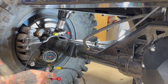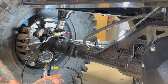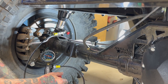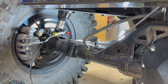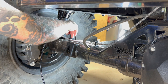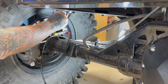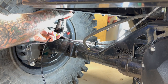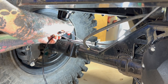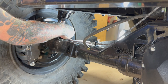When I open this valve it's going to allow me to increase the pressure in the strut, so we're going to go up to about the same as we did on the other side — nice and easy up to about 140 psi. Close that off. Now I'm going to close my Schrader valve by backing this screw out. You'll hear a little bit of gas escaping — just a little poof. And that's it. Put the cap back on the Schrader valve — super simple.